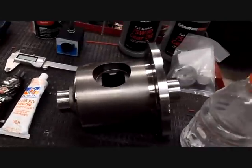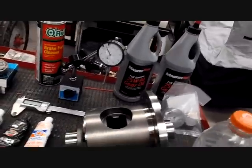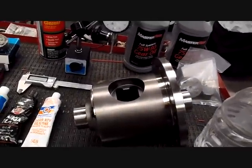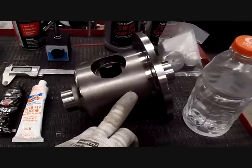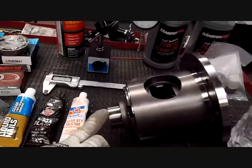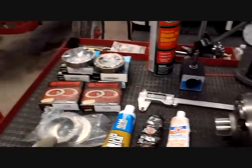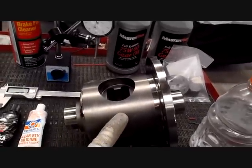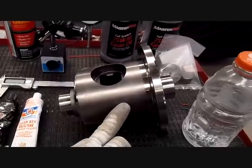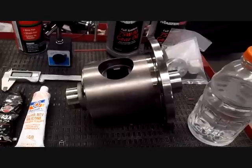There's something I want to hit on here. This is a 2000 Suburban and in the year 2000 they switched from an 8.5 inch differential to an 8.625 inch differential. The only thing I found that's different is the carrier bearings themselves - on the 8.625 they're probably about a quarter inch larger in diameter. The carrier, ring gear, pinion and all will interchange with the 8.5 or 8.625, commonly called the 8.6 ten-bolt differential.